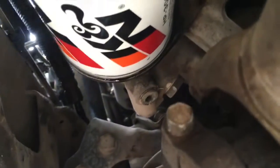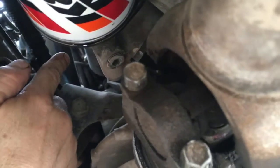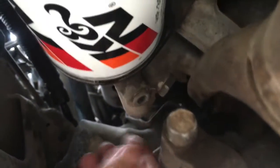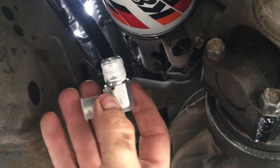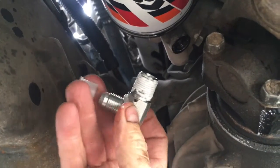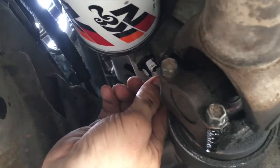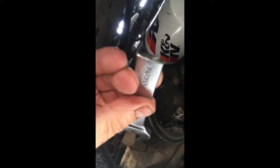We've chosen to take out the access port — the oil pressure supply port on the bottom of the oil filter housing right above the front driveline. The other one is up closer to the exhaust manifold and we want to avoid that. We've got a 5/16ths Allen wrench to break it loose and pull that plug out. Then we've got our Duramax elbow: one side will have the hose on it and the other side threads into our port. We've got some thread sealer on there and we want to get that good and snug — sometimes it helps to have a short-throw wrench to get in here. We're going to aim that so it faces back towards us.